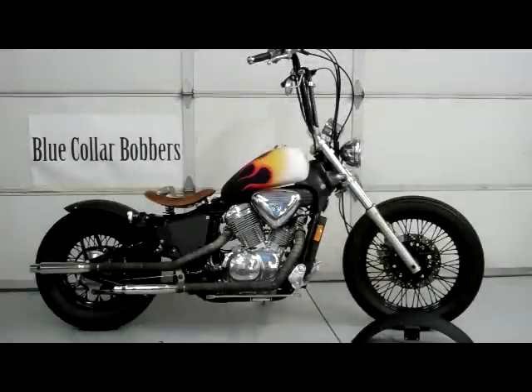Thank you very much for purchasing our 600 Honda Shadow Bobber kits. I'm going to go over some items that are really important to installing the kits, so pay close attention. First of all, we're running a 4.00-19 Coker Firestone Deluxe on the front of our bike. You can't run the stock fender with that tire, but if you run the stock size you can. That tire is from Coker Tire at C-O-K-E-R.